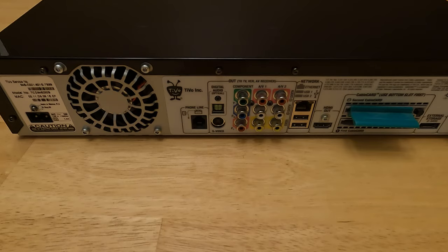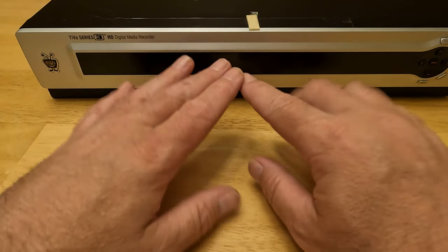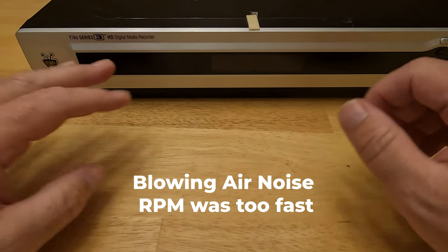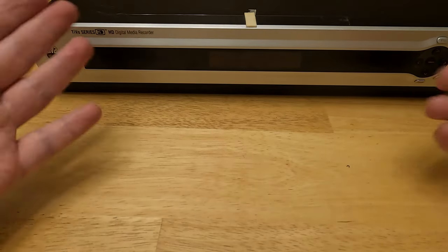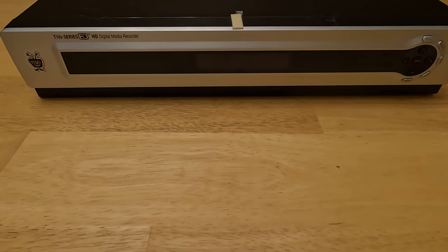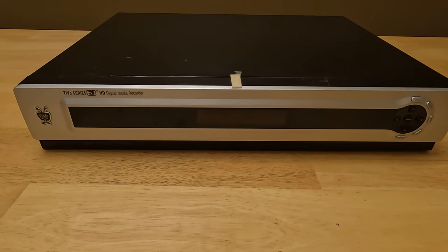Now we have all the screws mounted. We can go ahead and plug it in — what we're looking for is whether it powers on. I tried a fan out of another computer I had laying around the house; it was drawing more amperage and the TiVo Series 3 would not even power up with that fan, and it also made an awful lot of fan noise. That's why I ordered this specific quieter fan. They do have decibel ratings on fans so you can get a sense of noise, and also check the CFM. I'll put a link in the description to this fan as well as other recommended fans. They're pretty inexpensive — usually under five dollars, maybe ten dollars for a really nice one with better bearings.